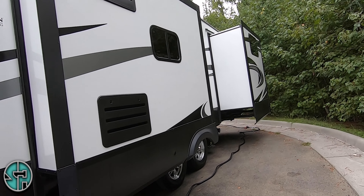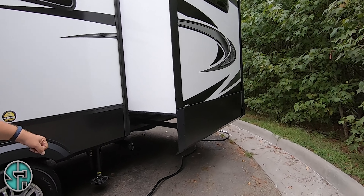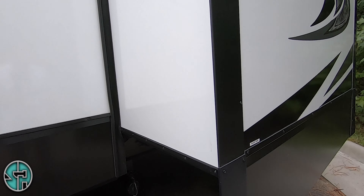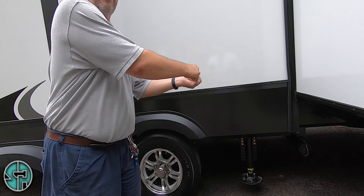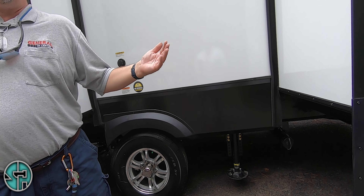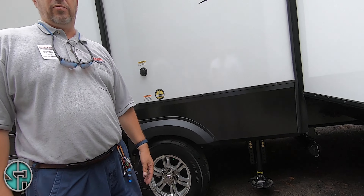You've got another connection down here for the rear bathroom, and you have a black handle right here to empty that one — and this is your black tank flush. Your handle is labeled right here, and this is your black tank flush for that one. You could use one hose or do this one, unhook it, bring it down there, hook it up and dump it. If you want two hoses you'd need a Y connection, but it's probably just easier to do that one and then come do this one — two flushes.